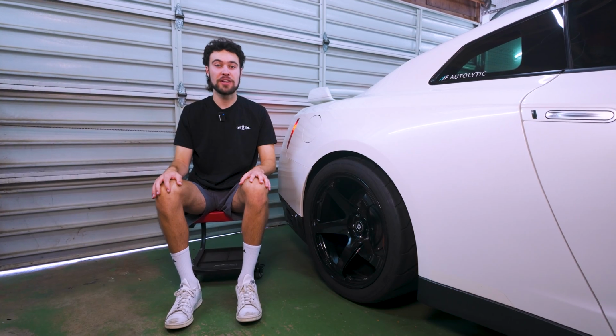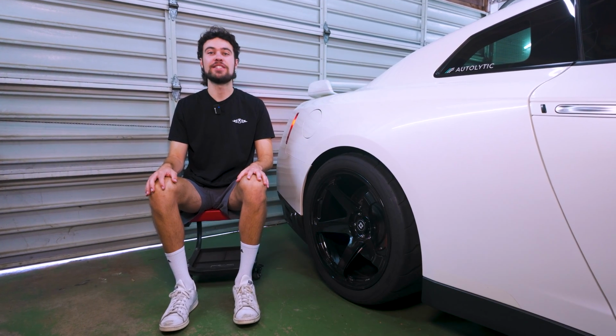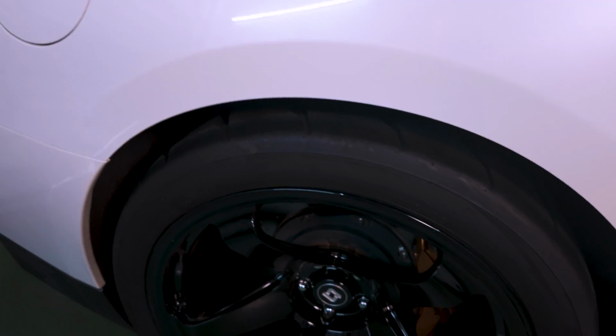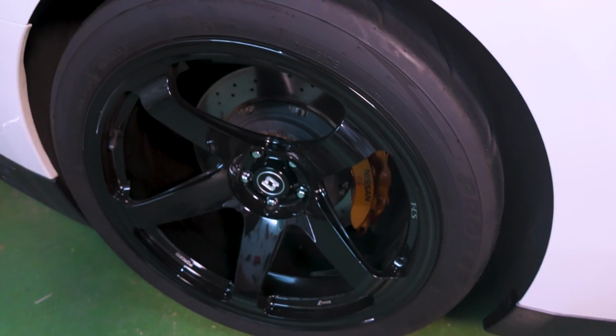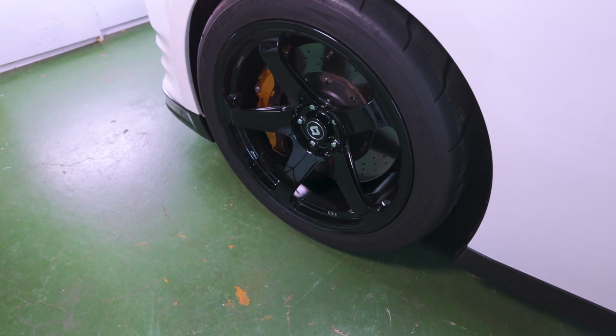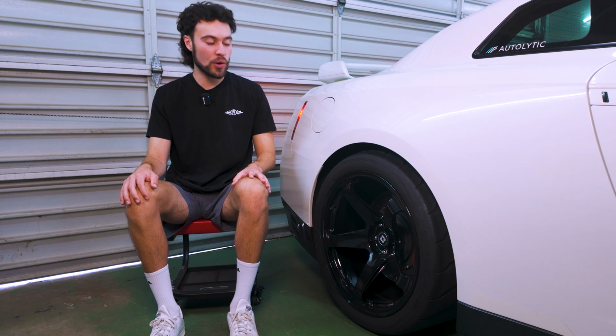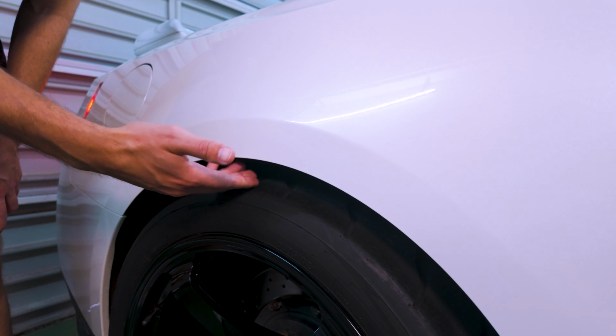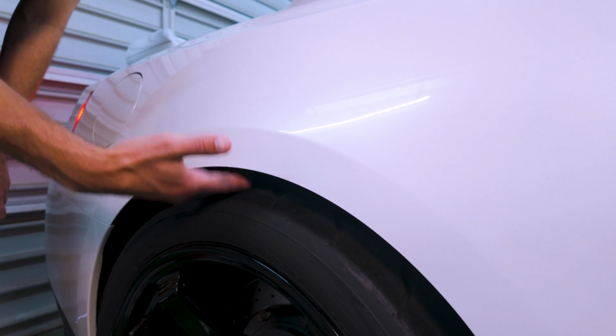I just picked up some new wheels and my fitment absolutely sucks. These are Titan7 T-C5 wheels. In the rear I have R35 tires 325/30/20. In the front I have 285/35/20. And right now I am on totally stock suspension, and there is about a 2-finger gap in the front and rear. The rear looks okay-ish, the front not so much.